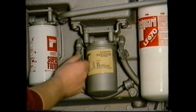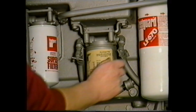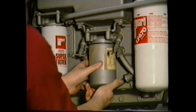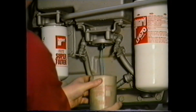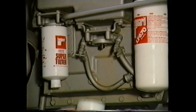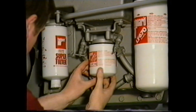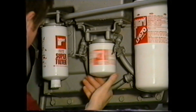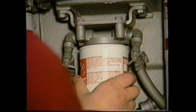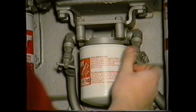To carry out routine maintenance, first turn off the 2 isolation taps and then unscrew the filter. Select a low-value service filter, in this instance 4 units. Prior to fitting, lubricate the seal. Again, do not over-tighten. Remember to turn the taps on.